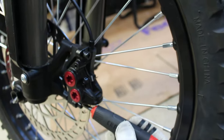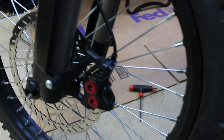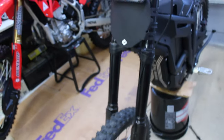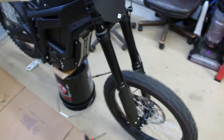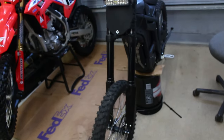Once you've got those back nice and snug, come back up to your strap — or whatever you used to hold the front brake — and pull that off. Now your front brake caliper should be perfectly centered. Let's go ahead and spin the wheel — nice spinning wheel right there. Do that same thing on the back caliper and you've got your brake calipers set up perfectly centered. You'll be good to go, less noise.